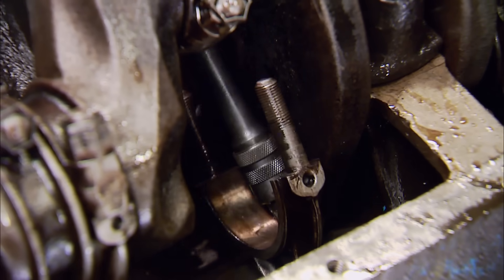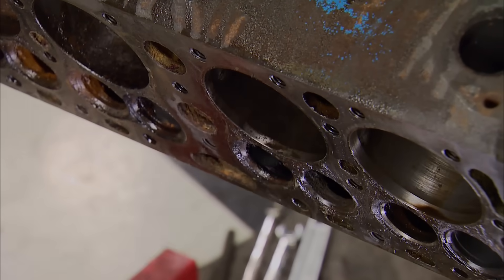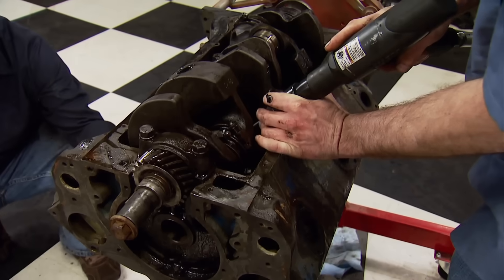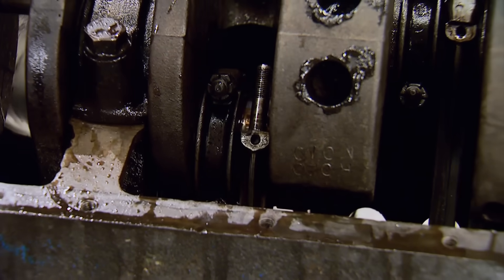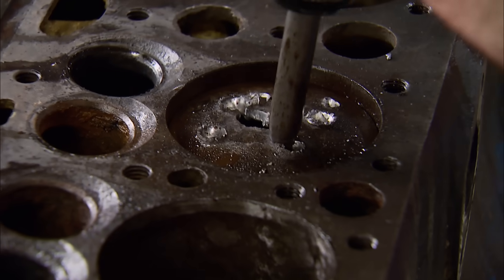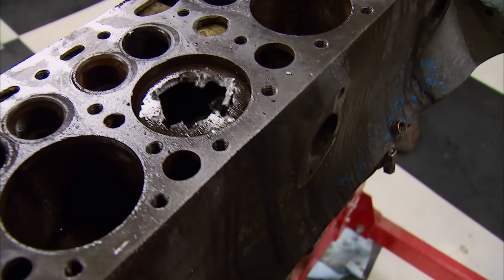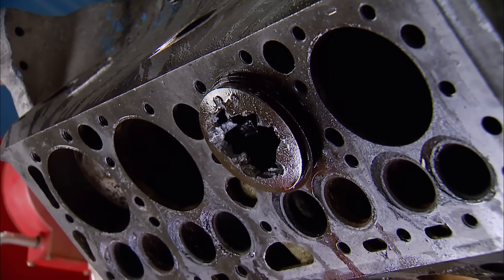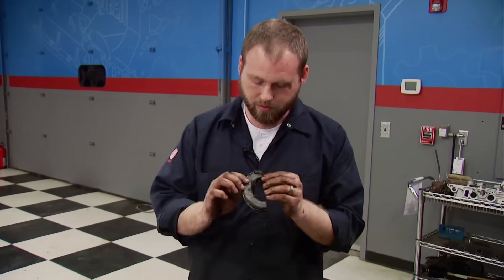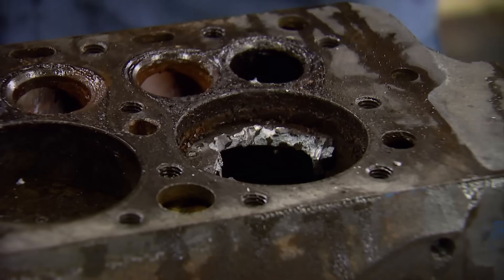Let's see if we can hammer them out. First one — we're off to a good start. And here's where it ends. We found the one. Roll it up, let's bust the piston. I'm amazed that any of them broke free. Only a few needed a little more persuasion. So by cutting or breaking away the center, we can remove the outer edges. Just be careful not to nick or scar the cylinder walls — you don't want to bore the cylinders any more than necessary.